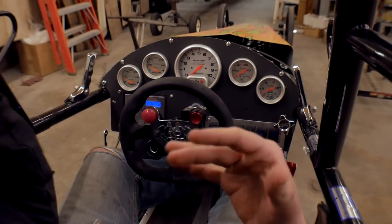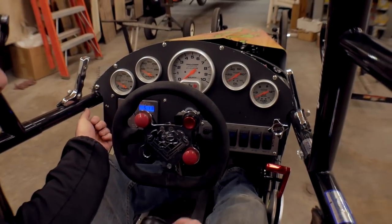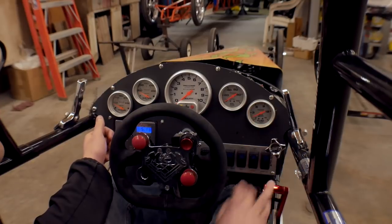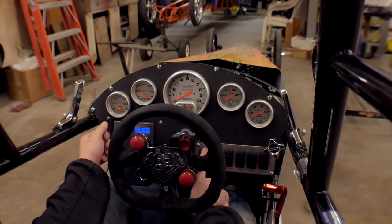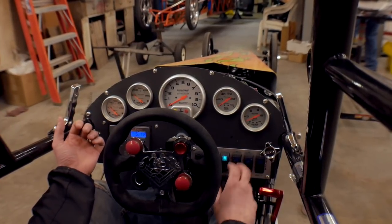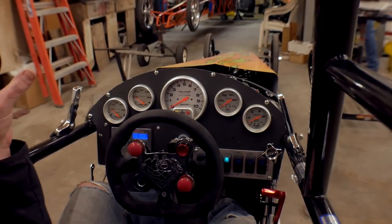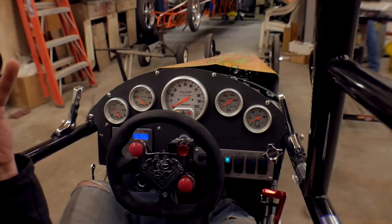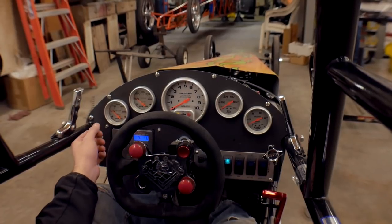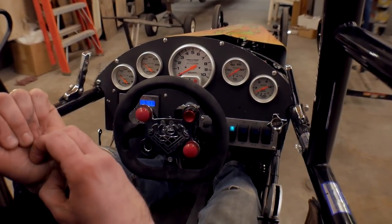So assuming we're strapped into the car, we got the helmet on, the neck collar on, all the safety gear, arm restraints, buckled in with the Pro One seat belt — we're ready to go on a pass. We're going to fire up the car by making sure the battery is turned on, turn on the ignition, and then hit the starter button. After the car is running, we'll make sure the temperature is good. Here's the water pump — we'll turn the fan on once we reach 150 degrees. I always like to monitor my temperatures very closely and make sure I have consistent water temperature and transmission fluid temperature every time I stage the car, as close as possible, for consistency. Then we'll drop the car into gear and roll through the water into the burnout box.